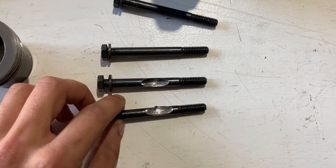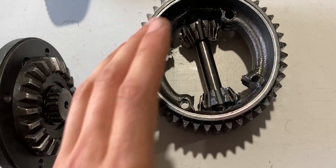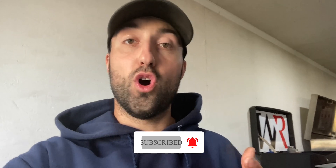I did not feel this when I was driving, for some reason. There was no vibration in the rear end whatsoever — there wasn't even any noise. The transmission powers the bull gear, and inside the bull gear everything is just chewed up and worn. That little shaft I can still repurpose, but the bull gear and the two running gears I'd have to replace, and I'm going to find them somewhere online hopefully.